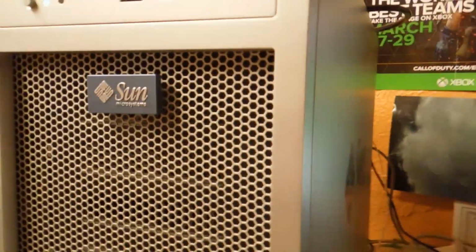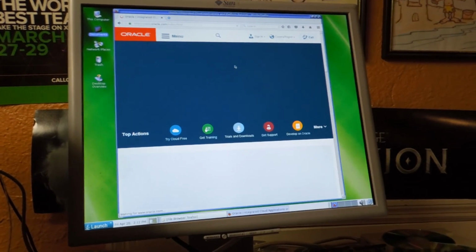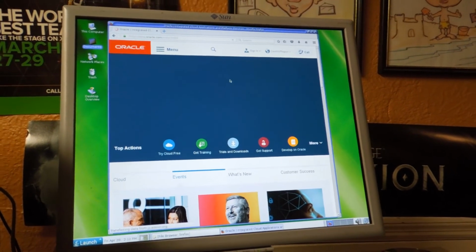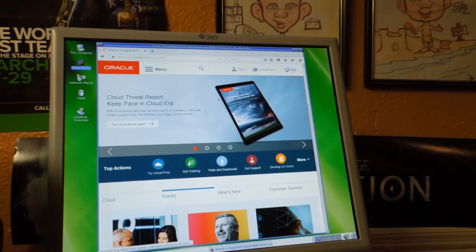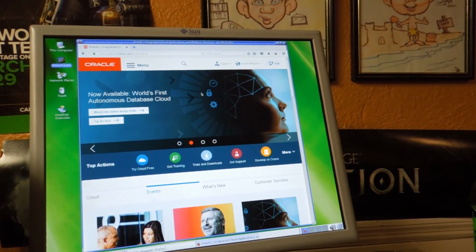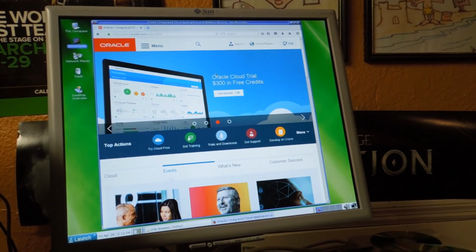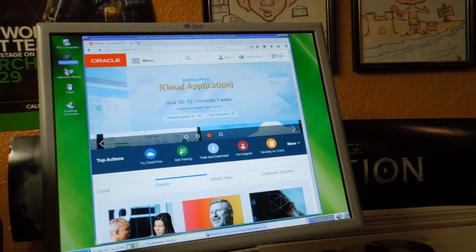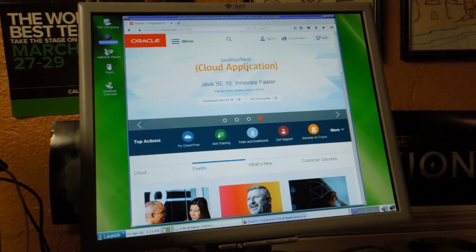So while we're at it, let me highlight something about these last Unix workstations. Many of them were kind of behind the curve. I mean, you had the IntelliStation POWER 285, which had the fastest CPUs IBM had, or at least the up-to-date ones with POWER5s in them, but they only had the same GXT6500P from the POWER3 era workstations. That was the best GPU you could get. The HP 9000s and the Alphas were similar, and the SGIs, they were just rehashing the same old hardware, especially the 9000s, which had the same old PA-RISC CPU that they quit updating because of Itanium.